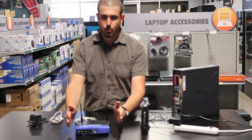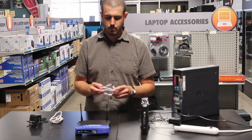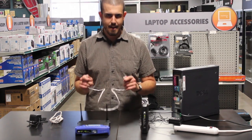While we're doing that, we're going to get started with your wireless router. You're going to need to connect your wireless router to your modem. We've got a short ethernet cable here — this one's a cat5e. You can also use cat6, but you probably don't want to use anything lower than cat5e.